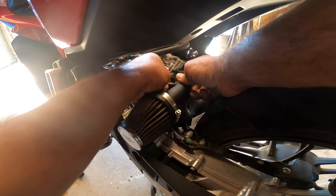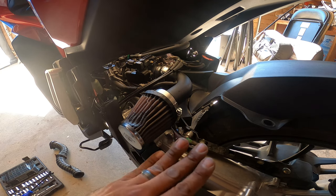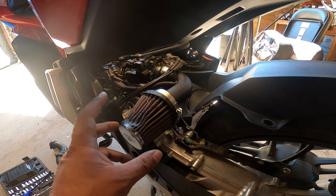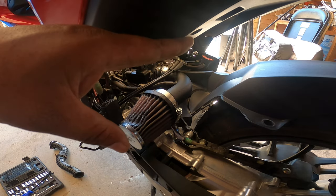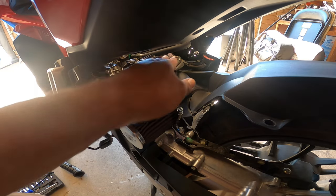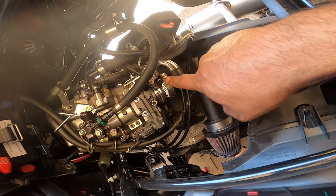Make sure it's pushed in as far as you can push it in, and it's underneath the throttle lines right here so it doesn't pinch or bend on anything. This I jacked up — it's my fault. I should have taken the air box out first but I thought I could leave it in without damaging anything, and I ended up damaging some stuff — primarily the filter, which is not a big deal, but now I've got to get it replaced. That's where you want it to sit because once you sit on your bike, the top of the body goes down and ends up sitting on this. Once you have that installed, tighten down your clamps — the two clamps on the throttle body — and make sure they're as straight as you can make them.